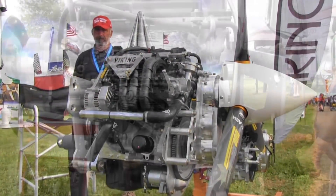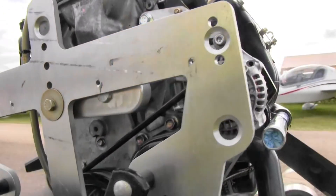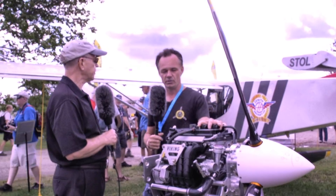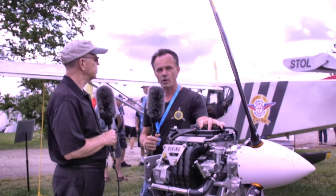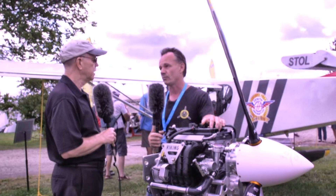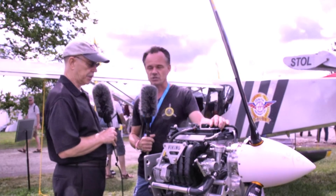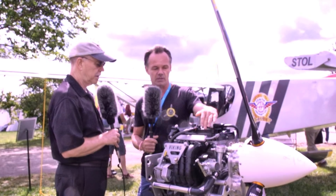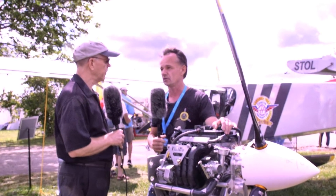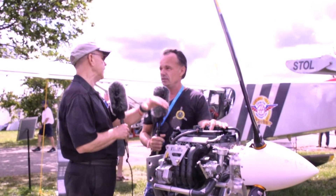So a new production Mitsubishi engine — they've done a lot of work to make sure it's a well-refined engine for their automobiles. Give me some of the parameters, like how fuel is fed to it. It's a 1.2-liter engine, and it produces peak power at 5,800 RPM, cruise at 5,400 — very like the Rotax numbers. It uses fuel injection — not direct injection like the Honda Fit engine, but port injection, meaning the fuel is injected into the intake manifold, and then the valve opens and draws it into the cylinder.